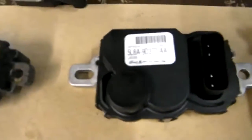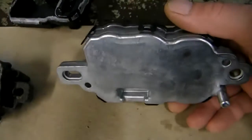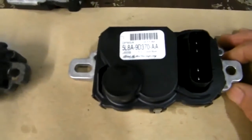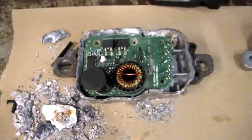Here's a new one. It cost about $175 from a Ford dealer in Canada — I imagine you can get them quite a bit cheaper in the States. You can see it's just a zinc die-cast metal body, and dissimilar metals, same old story, against steel. A little salt in the back there — it's underneath the car, and within a few years you've got a lot of corrosion.